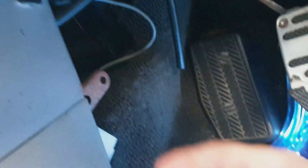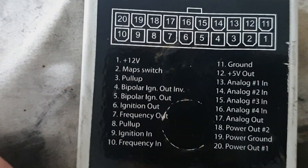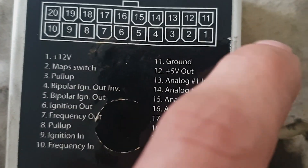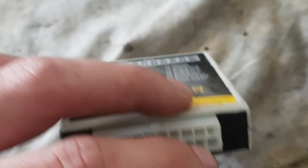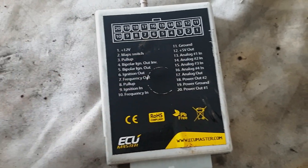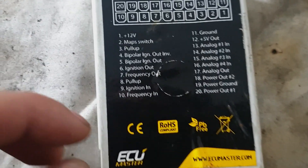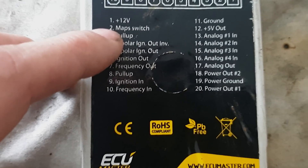You just tap into the timing — it's nice and hidden away in there, nice and clean and tidy. That wiring harness just comes around to this side where I've plugged into the ECU, so it just goes to this plug right here. You've got all your pin layout here, and they've got a square one here on the bottom right for the plug which is here on the bottom right — and vice versa for the actual adapter. It just plugs straight in and you can't really get it wrong. If you do get lost, the adapter has the numbers labeled all across the plugs for you.